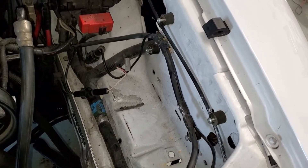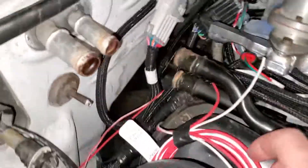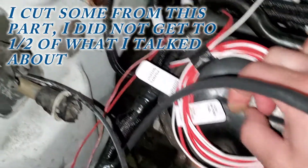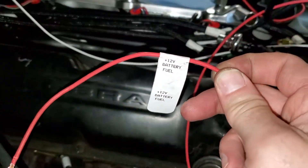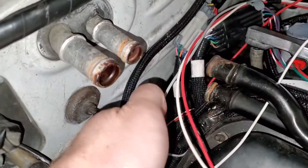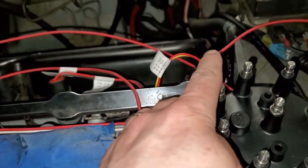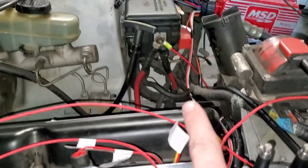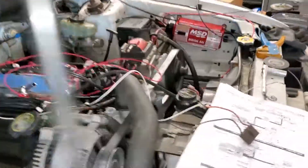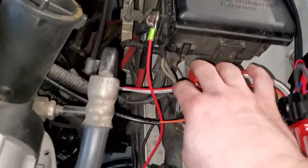Theoretically what I have to do is put the MSD box in, wired up using those two wires. The 12 volt battery from the terminator harness is down here. I'm gonna run it right here and then up behind the fuel rail and then kind of down that harness to that junction right here. This comes right from the battery that is in the trunk. These three wires are your tach, your points signal, and your switched 12 volt for the MSD.